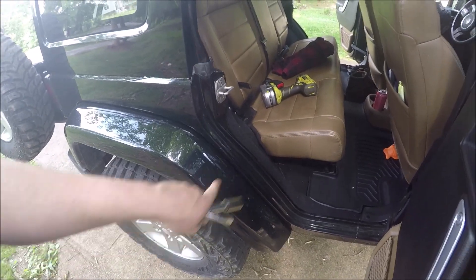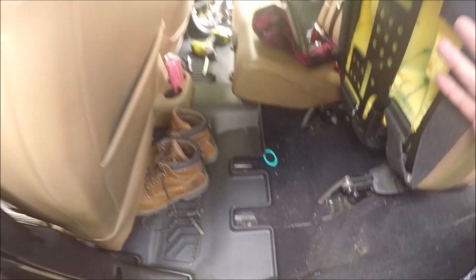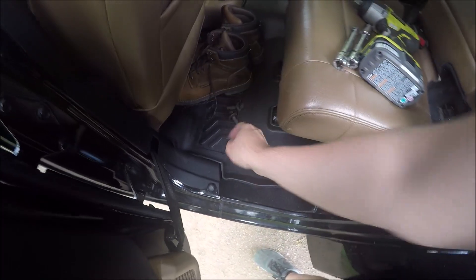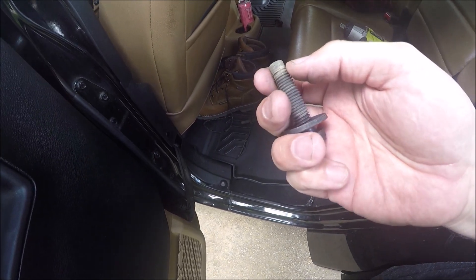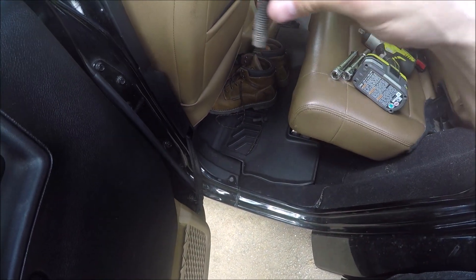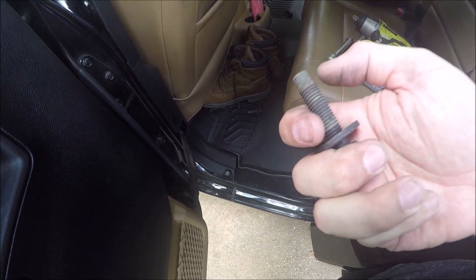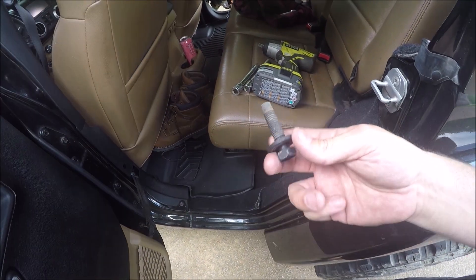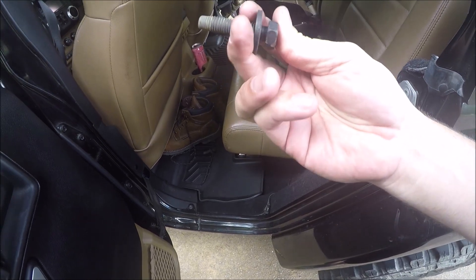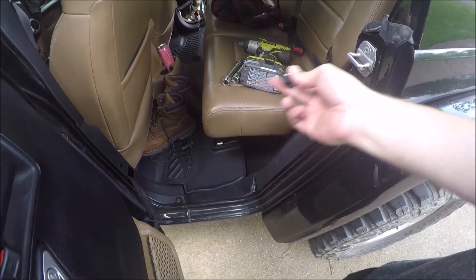Now there should be three bolts against the firewall where it comes down, but it'll be easier to get to those once I get these up and out of the way. I can already tell why people have such a hard time getting these restarted — it's because the new bolts don't have a shoulder, which allows you to get into the hole and get them started. See how the thread is tapered on the original bolt? The new bolts aren't like that, which is why they're so hard to start. That's also why a lot of people reuse the stock bolts where they can, so we may reuse some of these, especially on the smaller spacers in the back.